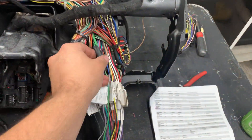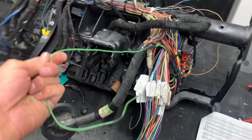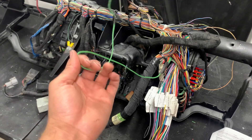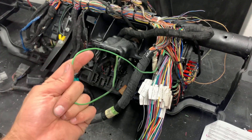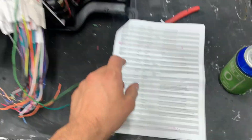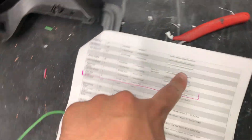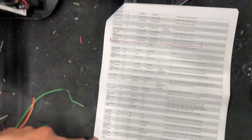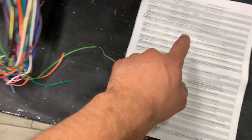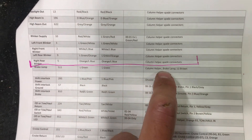This wire is for the brake pedal — when you hit the brake it lights up the brake lights. It's kind of an oddball out right now, so it's going to be the first one that I knock out. The pink ones lining up are ones we did on the board, so I don't need to do those. From here pretty much down is cutting and splicing, and the first one is the brake lamp — it says wire brake lamp to L1 brown.